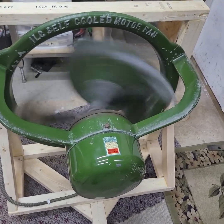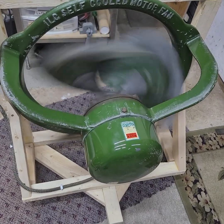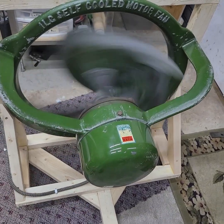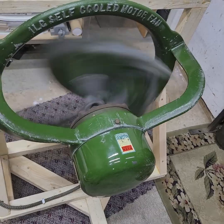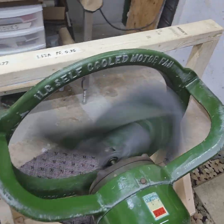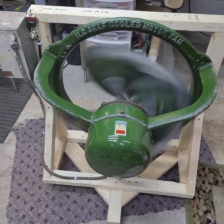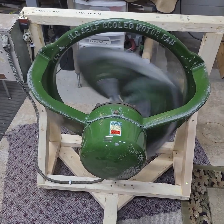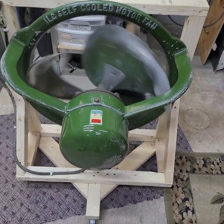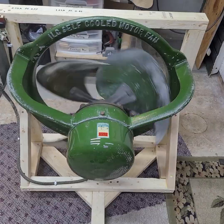It seems to work pretty much fine using a single capacitor for either speed. It's a nice, smooth, quiet fan — the bearings are still old so there's a little bearing noise — but it's definitely much quieter on low than on high, even though on high these ILGs are pretty quiet fans. So that's another fan converted to two-speed. If anybody has questions about how I did that, leave a comment — I can show you a wiring diagram or explain how the wiring of these motors and converter boxes works. Thanks for watching.